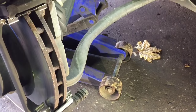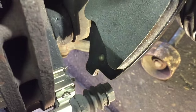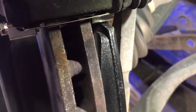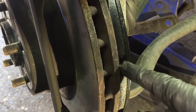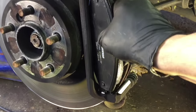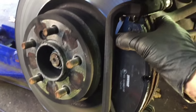Now I'll put the brakes on. I'm going to put the rear brake pad on first — you've got to push this guy in, push it down first, go up to the top, line that one up in the groove, and push it in. It should go right in — there we go, that's nice and flush. This is the brake pad we're going to put the brake sensor on. Now we're going to put the front brake pad on: remember the bottom end down, on angle, push in, and slide it right in.